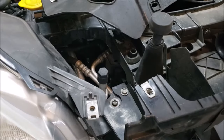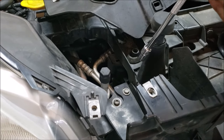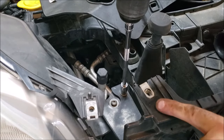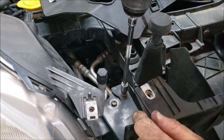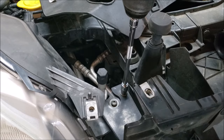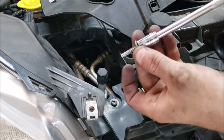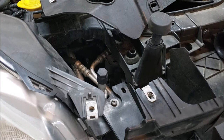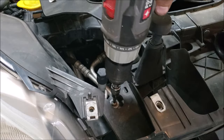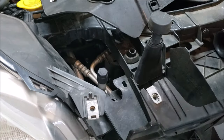Finally, after having the bumper cover removed, we can get to our headlights. Using a quarter inch extension and a 10mm socket, this plastic component is laying on top of the flange for the light, so we need to take this fastener off and lift this component off of the light flange. We're now going to use a T30 Torx driver and back this screw up — there's one of the three Torx screws.